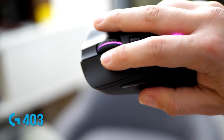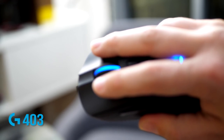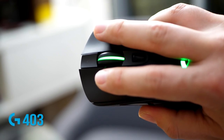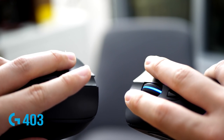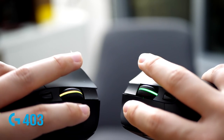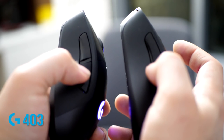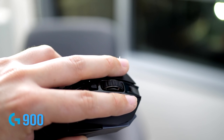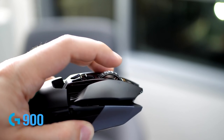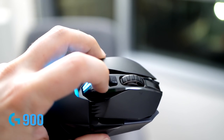The clicks are actually most consistent on the Logitech G403 — Omron switches rated for 20 million clicks, advertised with an approximate actuation force of 75 grams. However, they're exceptionally well implemented with a reduction in actuation force once inside the mouse. They're raised off the main PCB and positioned directly beneath with metal springs. I also love the separation in the shell, removing plastic flex from the equation for dedicated left and right click buttons, producing definitive, consistent, and endless crispiness. I have two G403s here and the pressure and responsiveness is the same between the two. The G900 also uses Omron switches with 20 million click durability — very responsive, reliable, with a tactile angle to match the top buttons, tensioning via metal springs and a metal pivot hinge — an innovative approach to lowering both the distance and force to actuation while giving great feedback and faster click recovery.